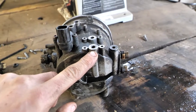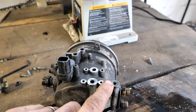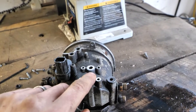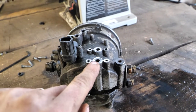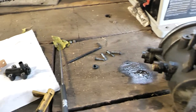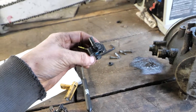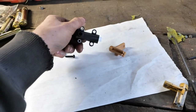To compensate for the leak — you can see there's a certain depth from this flat to these flats, and the O-rings do not protrude very much, if at all. This surface is supposed to be elevated above the screw holes to each side of it. Some moron decided to grind this to improve the O-ring's sealing surface, thereby lowering the surface that was to mate with the O-ring, thereby creating a leak. To solve that, they cranked down on these things like crazy, or put an oversized O-ring, and broke off this little plastic rim inside here, resulting in a leaky drain valve. So now I have a new drain valve — a very expensive piece of plastic. Take better care of it.